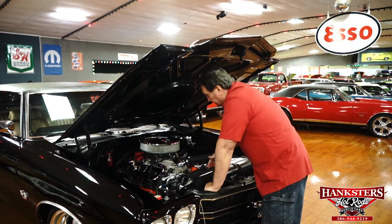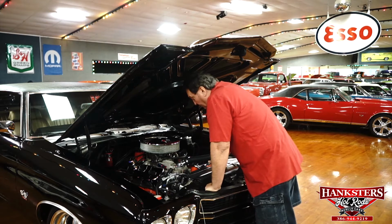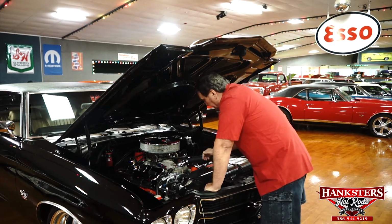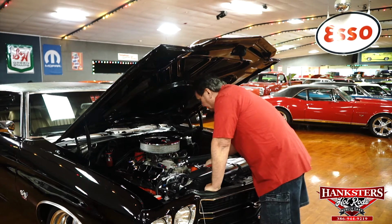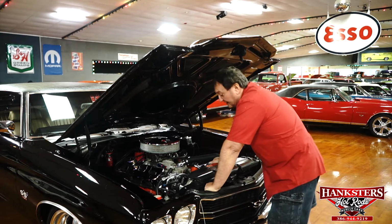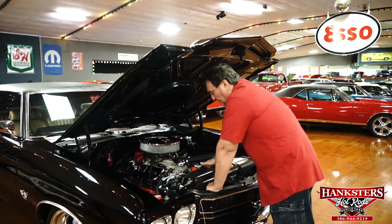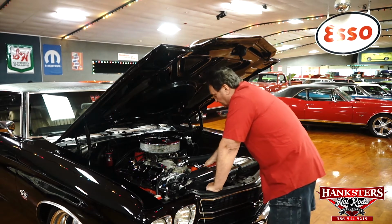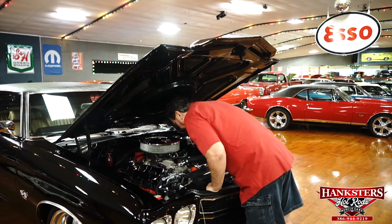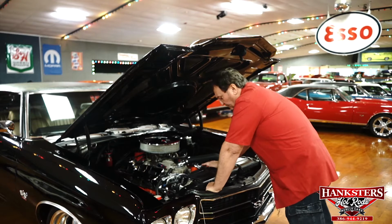The billet system that they used is for a serpentine belt, and all your pulleys are aluminum. The water pump drive, alternator, air conditioning, vibration damper, everything is billet aluminum on this vehicle. Very high-end. At least a 4-pass, big, huge, wide aluminum radiator in this vehicle also, with the correct shroud that comes with this vehicle, and 2 electric cooling fans as opposed to a mechanical fan.